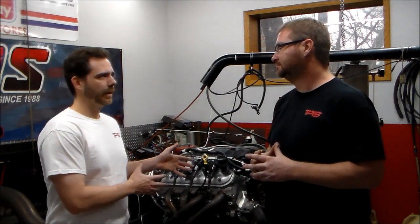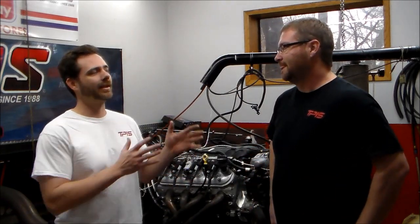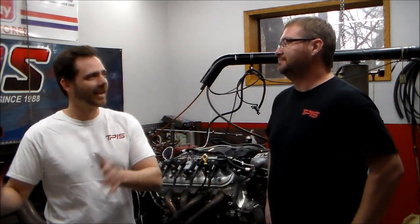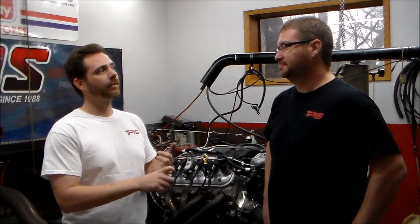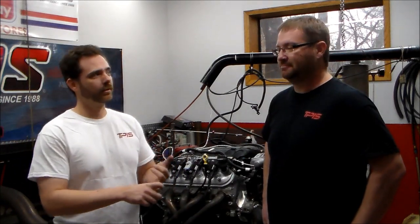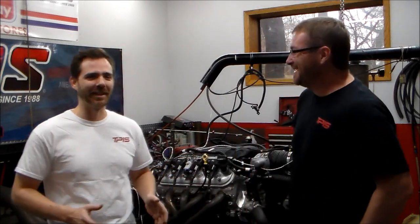Just generally make sure everything is working properly. There's a lot of stuff going on in the motor — a lot of moving parts, a lot of complicated things. You want to make sure it's working right, because it's a lot of work to take a motor, put it in a car, take it out, fix it, back and forth. This way you know exactly how much power it makes, and you can make adjustments if you need to — if it's too rich or too lean, you can move your camshaft advance, things like that.